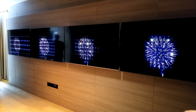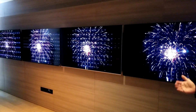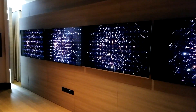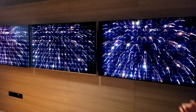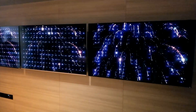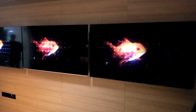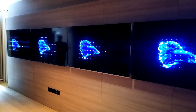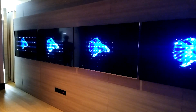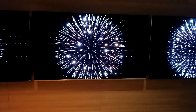We're the only manufacturer even today that puts local dimming in our entry-level E series, which absolutely helps with contrast. As you can see, stepping up within the line gives you more and more finite control of those zones. That not only improves black level as you step up, but also allows us to peak brightness more aggressively because we have finer control of those zones. You can see the goldfish swimming around — it's a little blockier on M series, but it still controls well, and as you step up to P and P Series Quantum, it's much tighter.